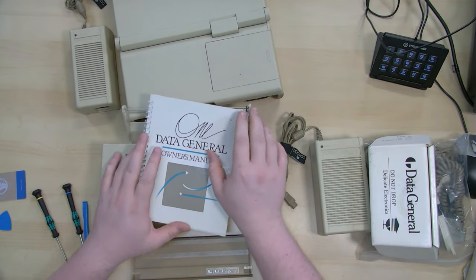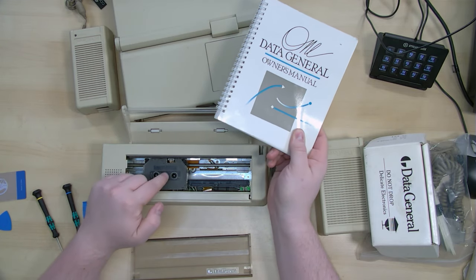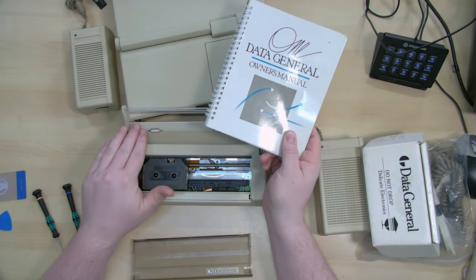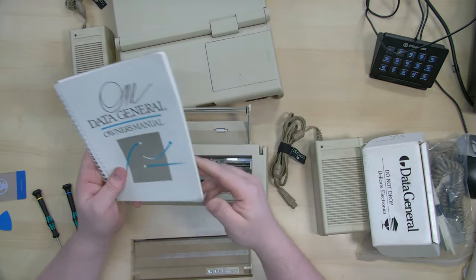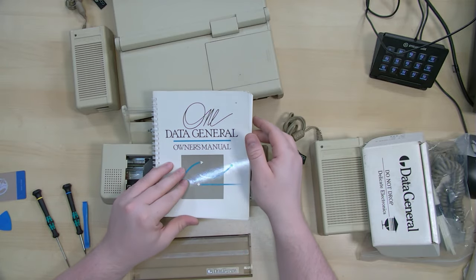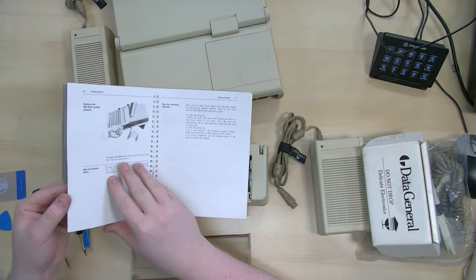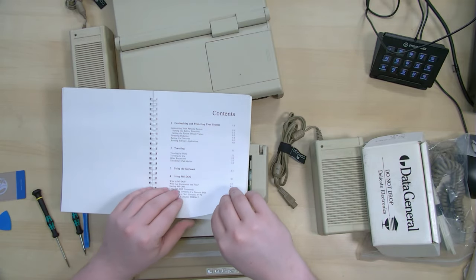I don't know if you remember the IBM convertible video. The printer could do either plain paper, in which case it uses a ribbon and it uses the thermal head to transfer the material to the paper. Or you take the ribbon out and you just put thermal paper through it and it just prints directly on the paper. And this is actually nearly universal. Most thermal printers can do either one because it's basically free. It's very easy to add.